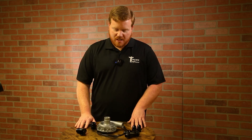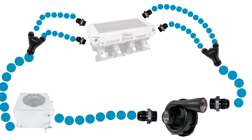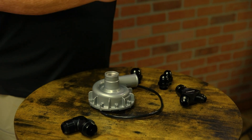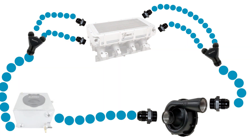The dual feed option comes with the Davies Craig 40 gallon per minute pump. Same 16 feed on the inlet side of the pump, and then a 16 outlet on the pump. From there we move from the pump to a Y fitting — we feed the Y fitting with a 16, and we have two 12s coming out. Going into the intercooler, we have our 12 O-ring to 12 male fittings. We're going to feed the front tank on both sides, which gives better distribution of flow and more flow, because we've moved the feeding hose up to a 16 and split it to two 12s.